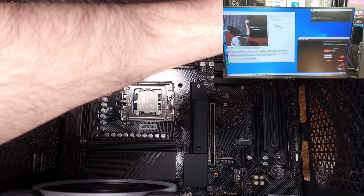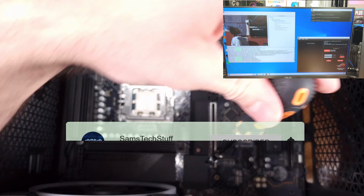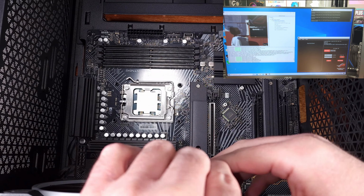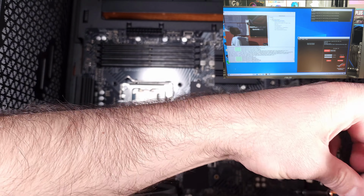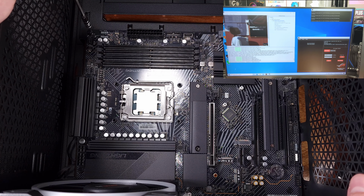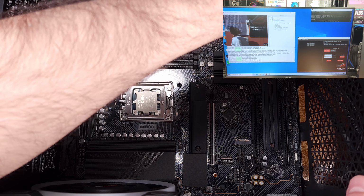This resulted in an average core temp of about 90 degrees Celsius across all of the cores, and during the test I noted a 5 GHz pretty much flat operating clock speed. The RTX 3060 Ti core averaged about 66.2C, and the core clock was around 1900 to 1920 MHz. The 100% fan speed test saw the Ryzen 7700X cores averaging 84.5C with an average clock speed of 5.05 to 5.1 GHz. As for the RTX 3060 Ti core temps, it averaged about 64C with an average core clock of